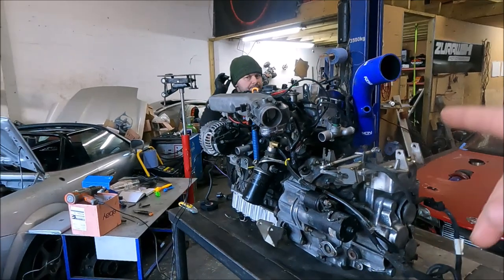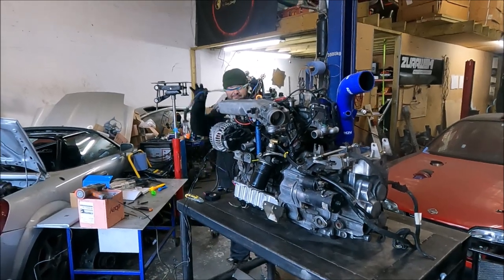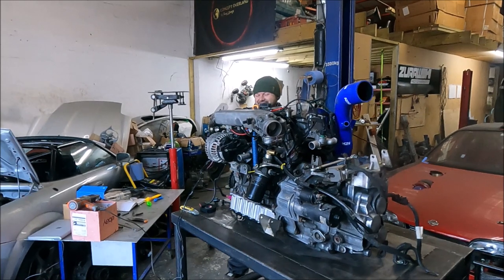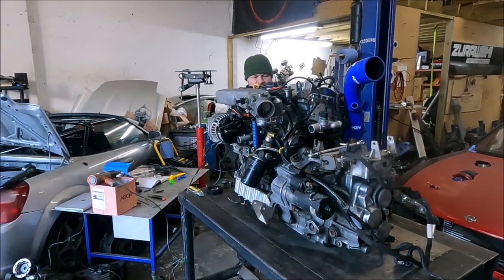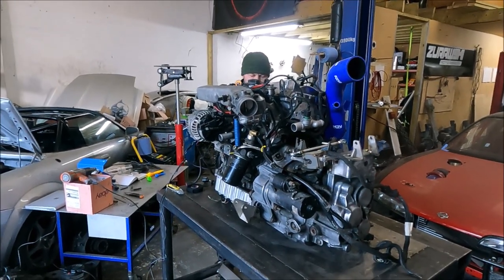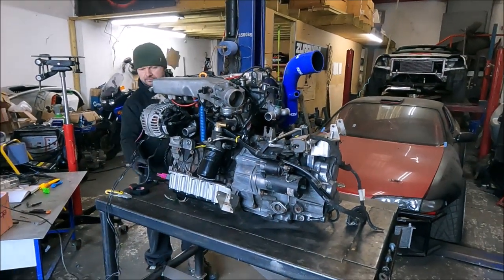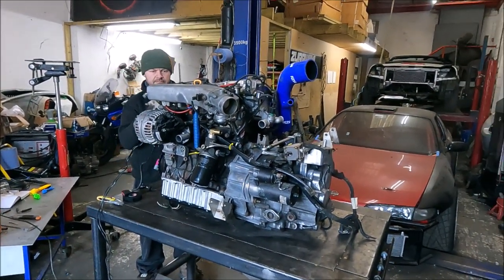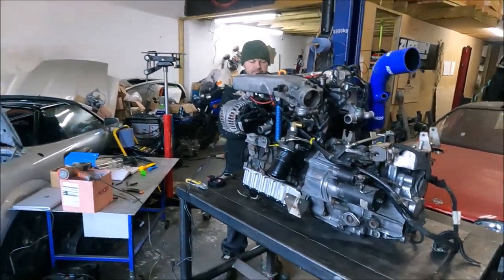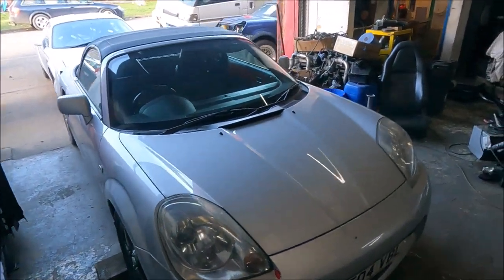The APXs are the early version of BAMs - basically the same, barring there's no wideband and no VVT. VVT doesn't make much difference on like this really, but wideband is very handy. Thanks to the way Volkswagen have done the wiring looms in a really good way, Thomas is able to adapt it now to work with the wideband, so that will be going in this one.